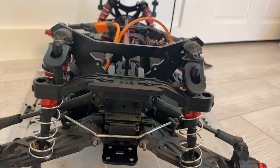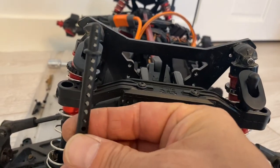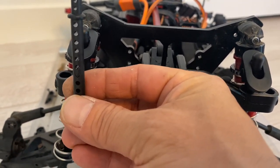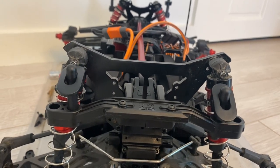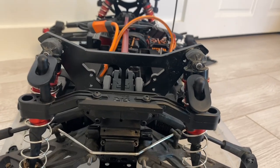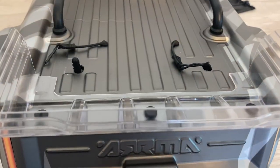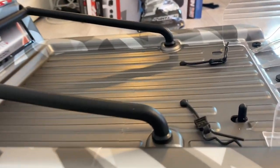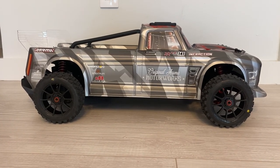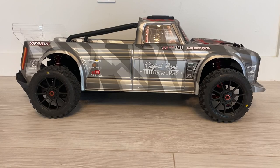I ran into a little problem with the Notorious rear shock tower — it is a little too tall to get the body to fit. So you need to get some different body mount posts that will clear the height of the shock tower. Make note of that because I did this conversion on my Felony but used a different rear shock tower. If you don't address this, the rear part of the body won't clip on. Adding a different body mount post seems to do the trick — the body is on both front and back with room to spare. Make note that with the shocks you can do different preload settings to affect ride height to your liking.